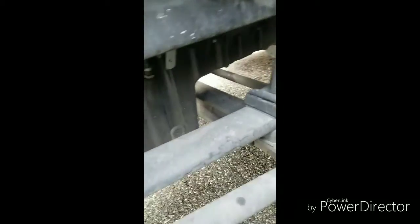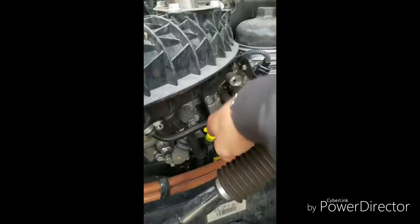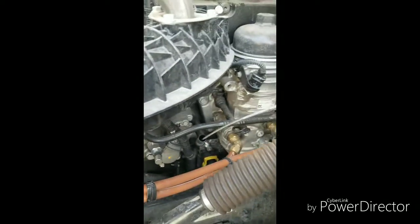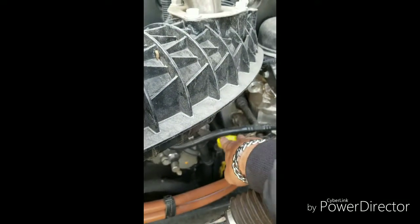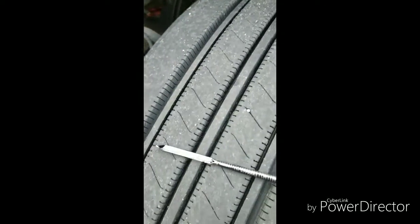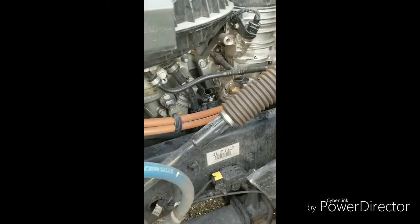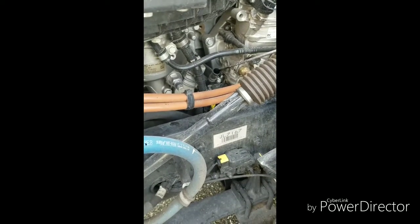Look underneath and make sure there's nothing dripping on the ground — all that stuff is an out-of-service violation. I'm running a DD15 engine in this truck. One of the things you want to do is check the oil right there — make sure it's full. If it's down at the minimum mark, that means it's a gallon empty. My company doesn't even want me to touch it until it gets to that minimum mark, and then they want me to put a full gallon in.